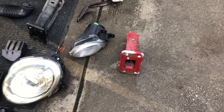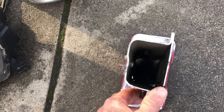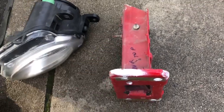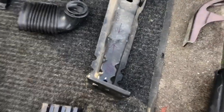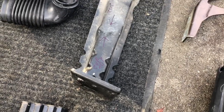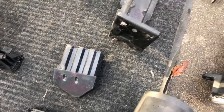You can see this sample of a cutoff frame rail — it was bent over about 25 degrees. I was able to get it straightened out as shown in a previous video. It's just sheet metal, so it's not too hard if you warm it up. With a long enough pole and a little leverage, I was able to generally get it straight enough so everything would go back together. There's the lower support — you can see where my arrows are showing the deflection. This little support post right here actually got sheared off.